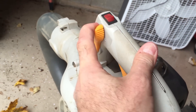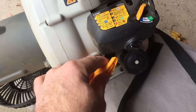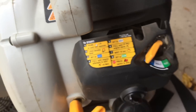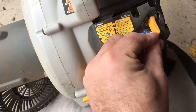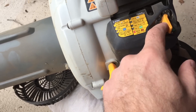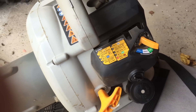You pull back this lever here, which pulls the throttle up, and you can then pull the cord four or five times and it should fire up. There are specific instructions on there. If it doesn't fire up first time, pull the choke back to half, give it four or five more pulls. Then as soon as it fires up, get it on to run. Anyway, let's get on with the demo.